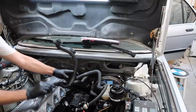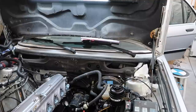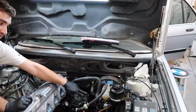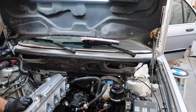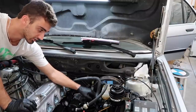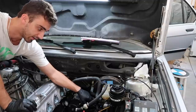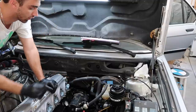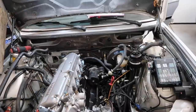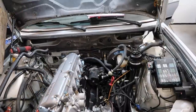We'll lay this in there. So that's good. Just want that from a donor M30. But then what you have to do is figure out the one hose that goes to the heater valve. So the heater valve is in a different location on the M20 cars versus the 535s. It's down here lower, so you need a longer hose. The hose that they give you for this part number, I bought that since I don't need it because I have the spider hose.